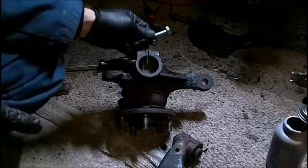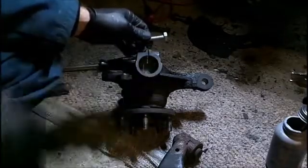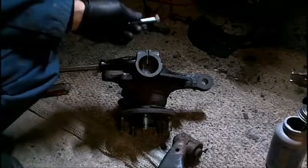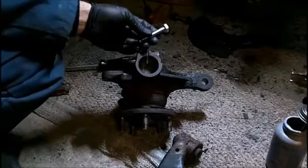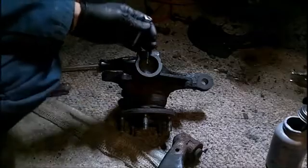One keynote, I did check on the opposite side of the vehicle, turning the wheel all the way the opposite direction just to verify. Everything looked okay. So now I'm going to go ahead and move forward with getting the ball joint in there, getting it all lubed up with anti-seize. The same thing with this screw, the lock washer and nut, and I'm going to go ahead and do the assembly. I'll explain it to you later.